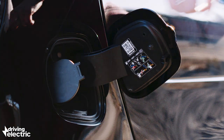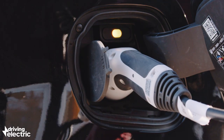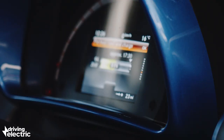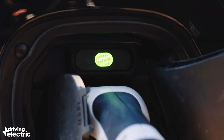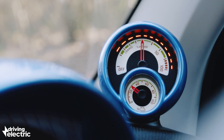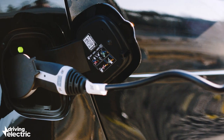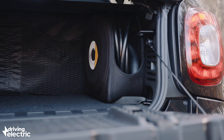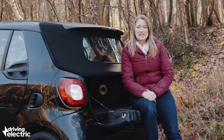It's easy to plug the Smart ForTwo in — it comes with a standard 3-pin and Type 2 public charging cable, and you just pop the flap at the back of the car and plug it in. Connect it to a 7kW home charger and you'll charge the 17.6kWh battery in around two and a half hours. It can accept up to 22kW, so a public fast charger gets you to 80% in under 40 minutes. A normal domestic socket will fully charge the car in around eight hours, costing about £2.50 to £3. There's also a hook in the boot to hang the cable bag off — quick, cheap, and easy.